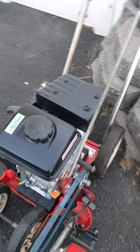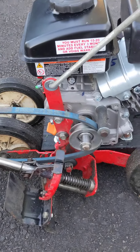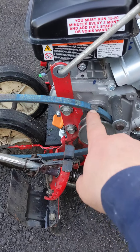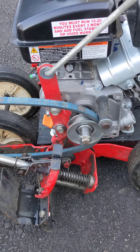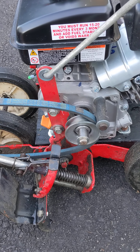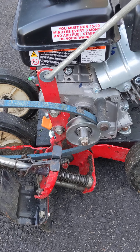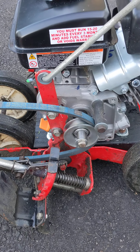The output side lined up perfectly. I went to Tractor Supply and bought a two and a half inch diameter pulley. The crankshaft on these little Predators is five-eighths — it came with a keyway and it came with the bolts.